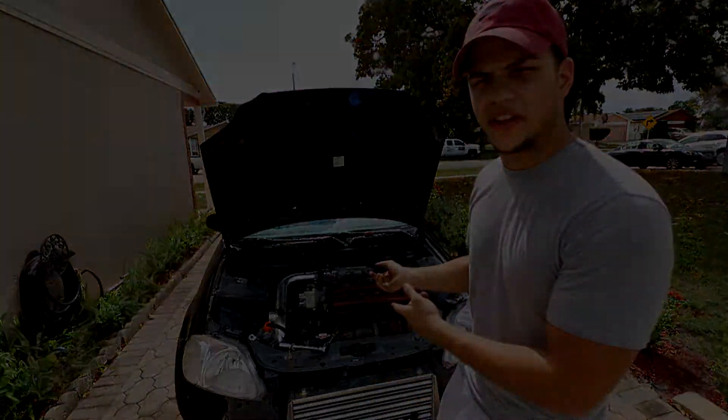I think we found our culprit, and it's always number one on the Honda. The highest reading was 90 — not even 85 on some — so we're not looking good. That confirms what I had in mind: cylinder number one is very low. The reason is that once boost builds up and gets shoved into the intake manifold, it rushes to the back and into cylinder number one, which always receives more boost than the others. That's a known fact — that's why those cylinders always go first. I was not expecting all three cylinders to be that low; the highest was about 90.